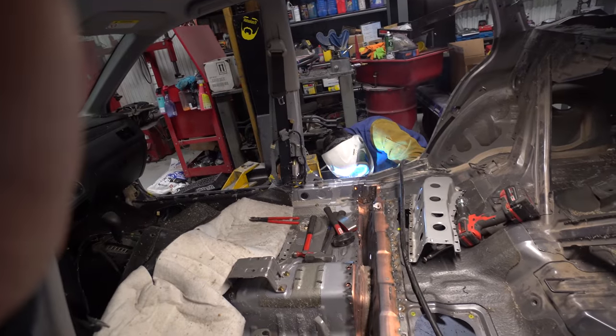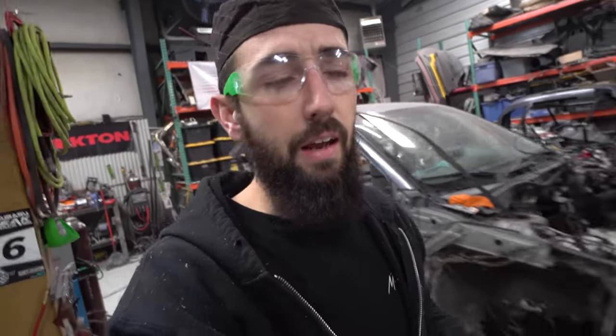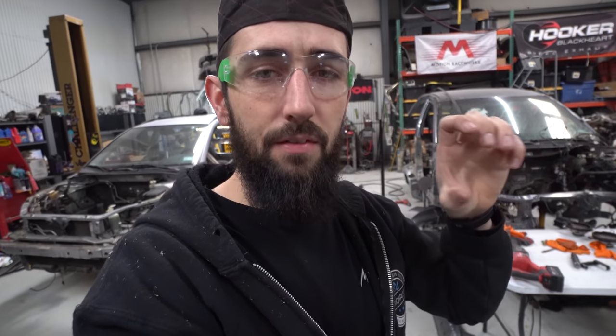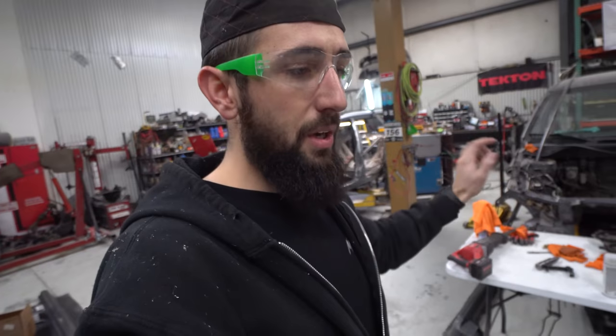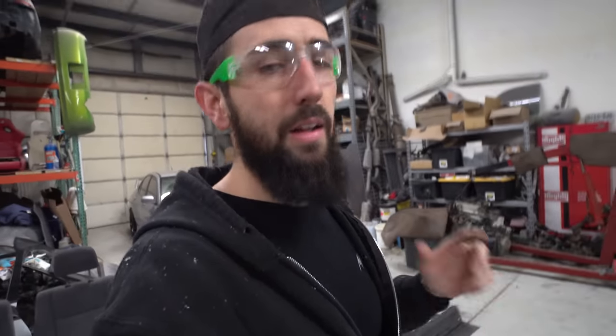So Sean is over there. And we have it. So it basically pulses for 0.7 of a second and it's off for 0.3 of a second. And so what that does is it really lets the metal kind of cool down since this stuff is so thin. We'll get into a little bit more with that welder later, but pretty stoked on it. We were testing it, did a bunch of little test panels with it, and I really got it dialed in.